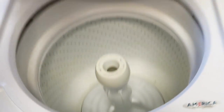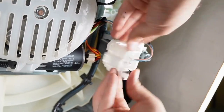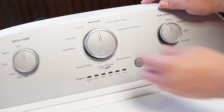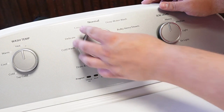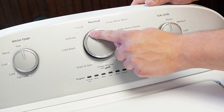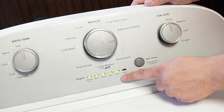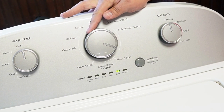Now that we've done the first reset, let's attempt to recalibrate this washing machine through the calibration mode. This is a must-do if you've installed any new parts on the washing machine, from a board to a balancing rod. With the washing machine freshly rebooted, rotate the dial counterclockwise 360 degrees. Then turn the knob right three clicks, left once, then right once again. It should be pointing at 3 o'clock at this point. You need to do all these things within three seconds, and it may take a few attempts, but if done right, all the lights at the bottom of the washing machine control should flash on and off, showing that you've entered into the diagnostic mode.